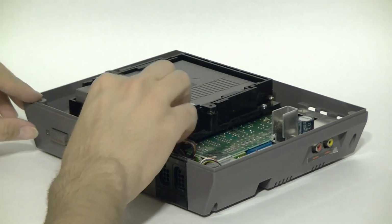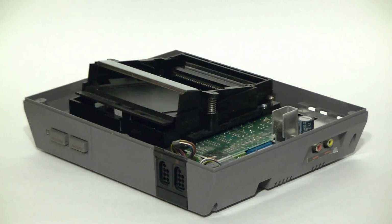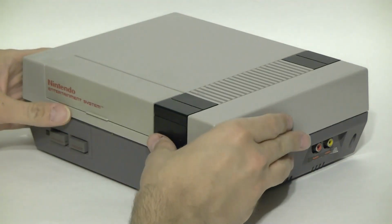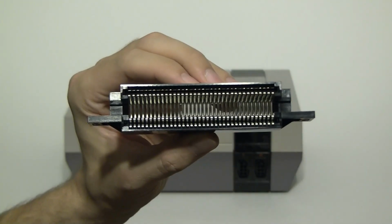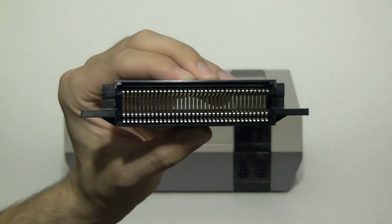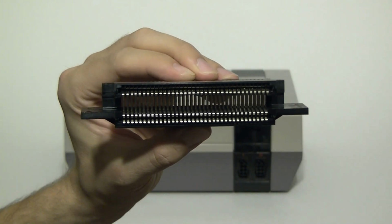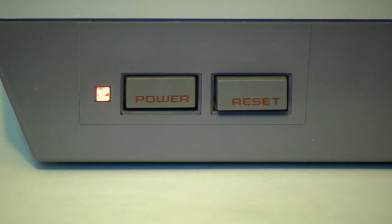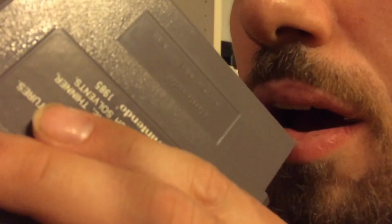Nintendo decided that the VCR-style slot would be a definite feature of the updated Famicom hardware, and designed the toaster shell around it. This design required a set of springy pins that unfortunately can get dirty, erode, or just become less springy over time, causing communication problems with the 10NES chip, leading to the fabled red blinking light. Just don't blow it. No!